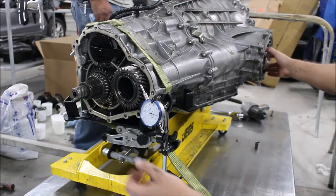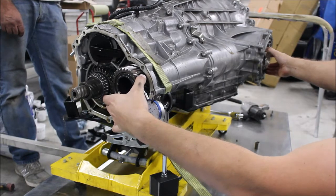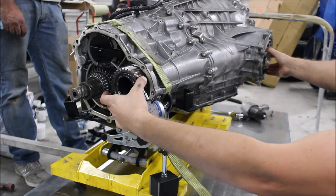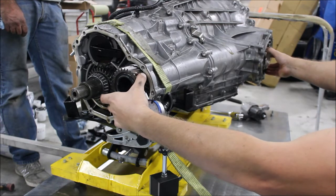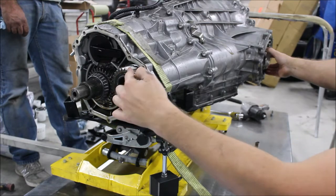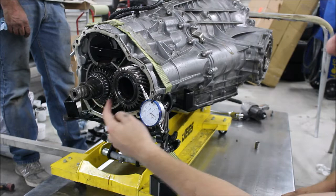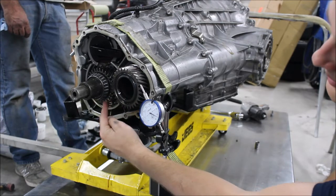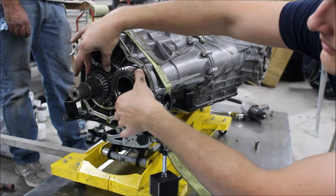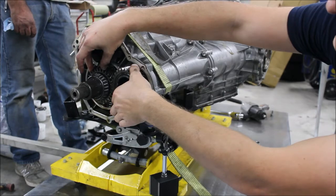If you just hold the front stub axle and rotate this a little bit, you'll feel a little knock in your right hand through that stub axle. That's the backlash we're trying to measure — the free play between this shaft and the differential. We don't want to measure the free play between this gear and that gear, which you can see is usually much less. If you hold this one constant and wiggle this one, you'll feel how much play there is.